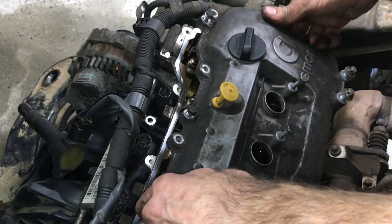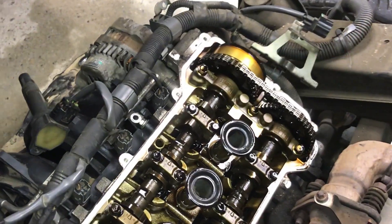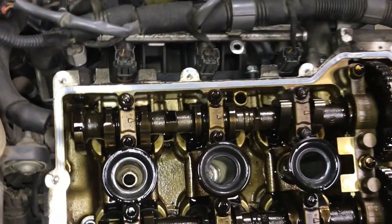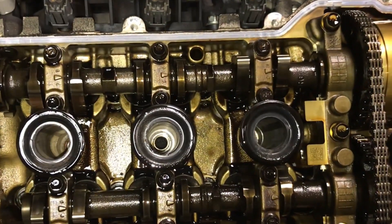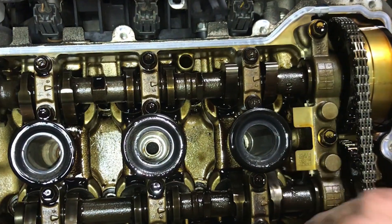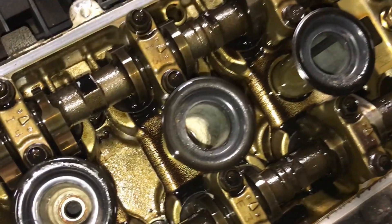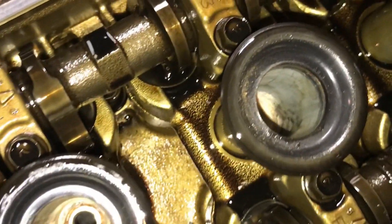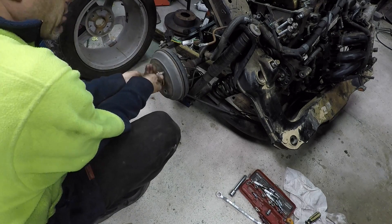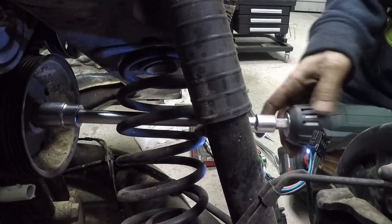Welcome back. In this video I pull the engine apart and finally figure out what's actually gone wrong with this engine. I start taking off the cam cover and have a quick look — the timing chain is still tensioned, looks good, the oil looks clean, the cam lobes have literally no wear on them, so the top of the head looks perfect. I'm very surprised for a car that's done a hundred thousand k's. It looks like I need to take the head off, and to do that I need to get this crank pulley off.